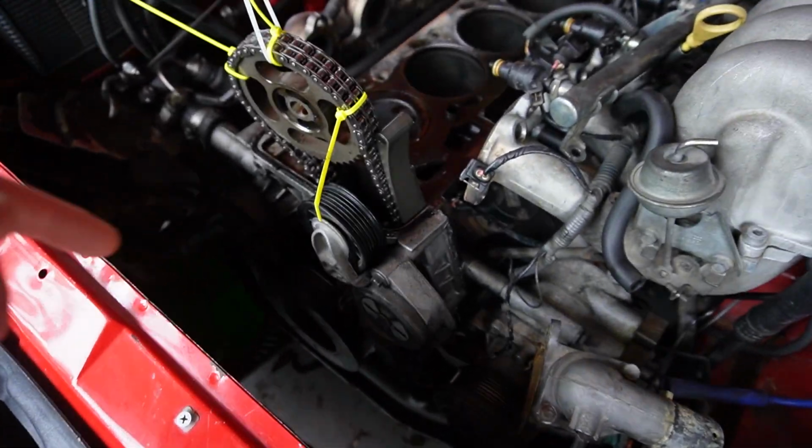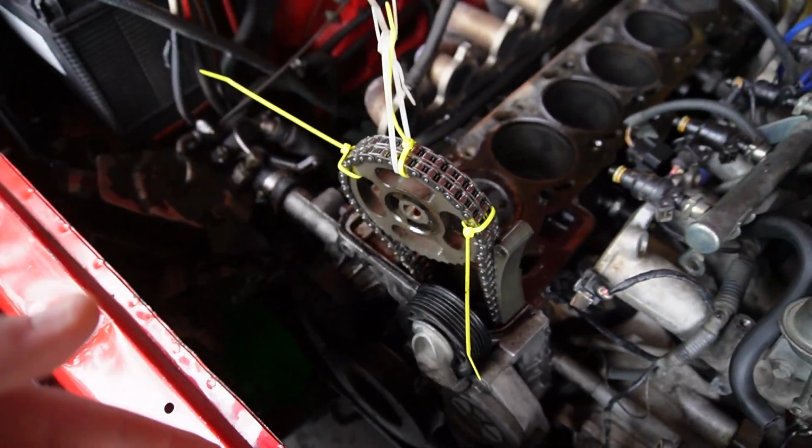Anyway, I'll be dropping the head off very shortly. Hopefully in the next video, I'll be taking the timing cover off, resealing it, resealing the sump, and possibly even tapping a turbo drain into the sump to prepare it to function in the future. But I don't want to be taking the sump off again because apparently they're a bit of a pain in the ass to do on these engines. I will be pulling the timing cover off, like I said, and cleaning up the block to prepare it for the refreshed head to go back on.